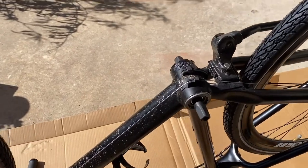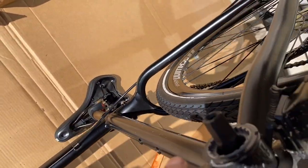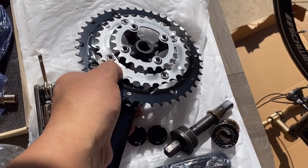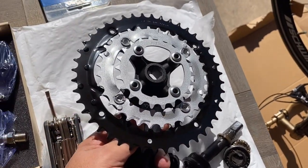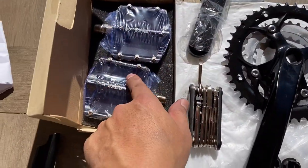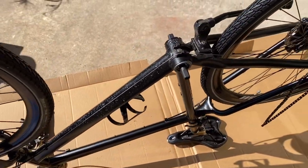Moving right along — that part's done. We've installed the new sealed bottom bracket bearing assembly and as you can see it spins very nice and smooth. Both sides are locked in. Now we're ready to start on the crankset. We're going to remove the low and mid sprockets and keep the high, so we're going with a single. We'll loosen the Allen wrench screws, keep all the old hardware as spares, then mount the pedals, replace the chain, and we're pretty much done.